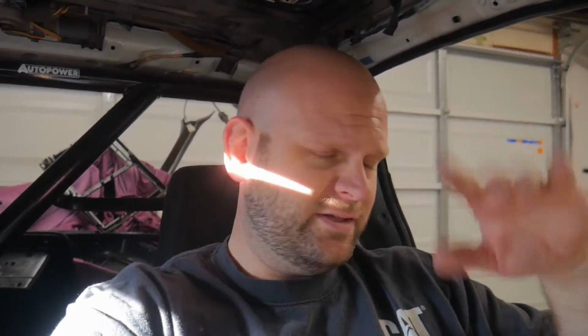But I think now I realize that if the Haltech is getting a bad ground or bad signal from any of the 5-volt references, they all seem to be connected in the ECU. So if you have the 5-volt reference error, all of your sensors are going to be saying they're wrong. You saw the error codes I showed you before. Every single throttle position, everything was wrong, saying the intake air temperature is 240 degrees and coolant temperature, etc. So if the weather sealing is not perfect on that, and water got in there and caused a little bit of a problem, I don't know.